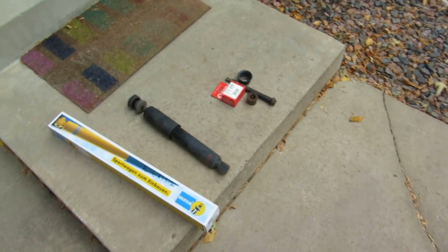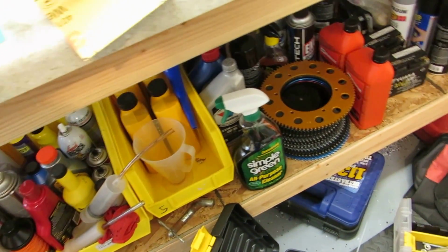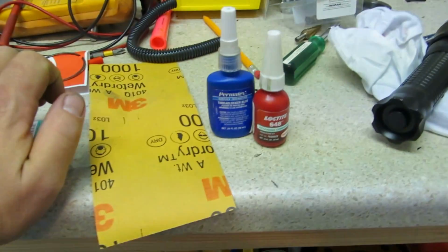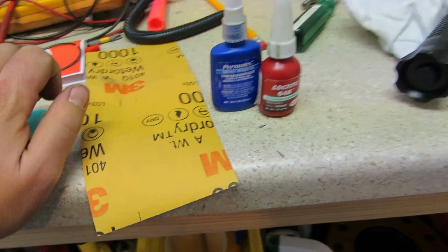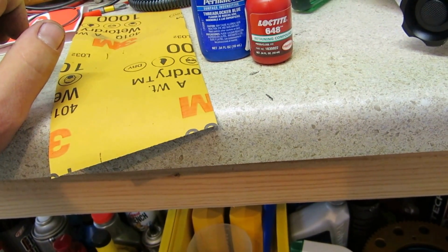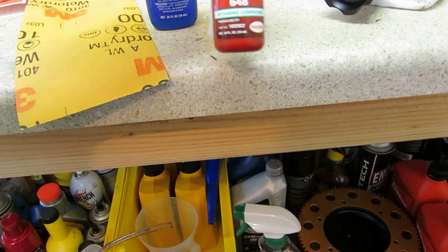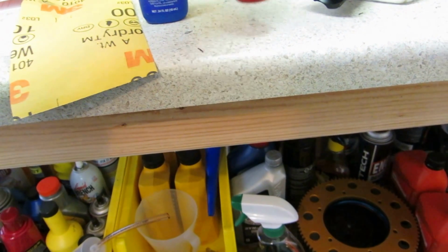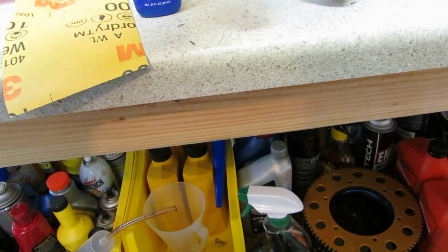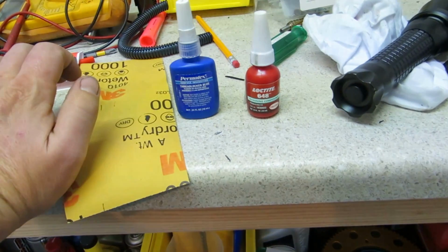The other thing while assembling: Loctite on the bolt coming through the radius arm and the control arm up front. On that first nut I tightened down to lock all the main big components together. Use a 648 Loctite. This stuff is crazy strong. It takes like 500 degrees to break it down. Has enough tensile strength it'll rip aluminum.